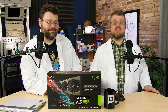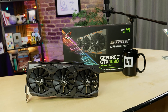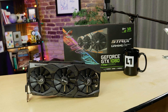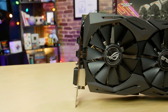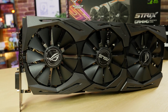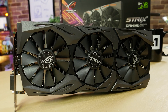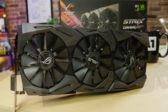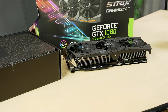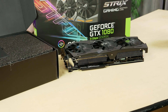This is an NVIDIA GeForce GTX 1080. It's PCI Express 3.0 x16, with OpenGL 4.5 support and GDDR5X 8 gig. In OC mode, which you get when you install the overclock software, the boost clock is 1860 MHz with a base clock of 1721. The default out-of-the-box mode is a boost clock of 1835 with a GPU base clock of 1695. It has 2560 CUDA cores and a 256-bit memory interface.